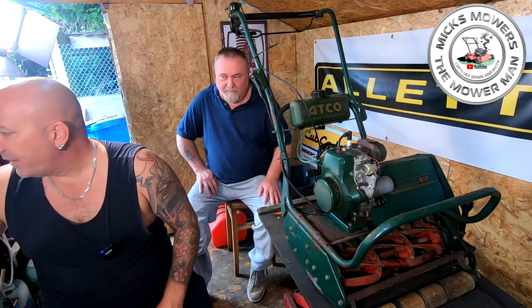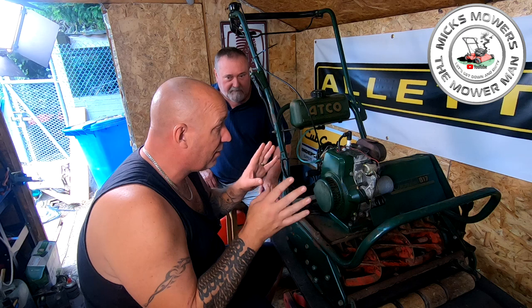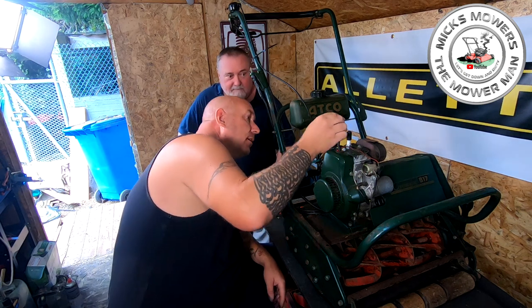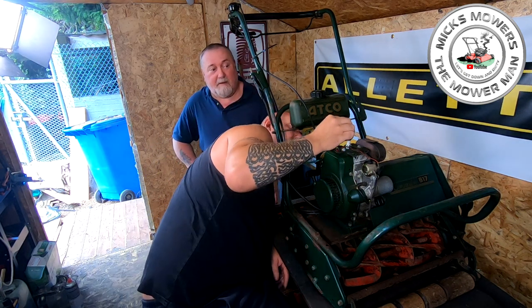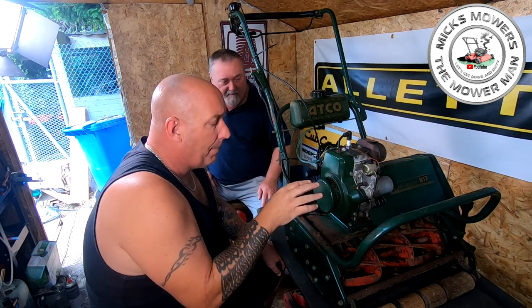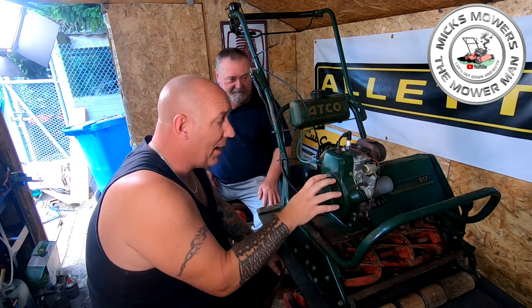But that's running lovely now. Well, it's running as well as to be expected for a machine of this age. So what we're going to do is, we'll take this outside, we'll put some more fuel in. What plug have you got in there? It's brand new. It's a B6S. Okay. I thought it was a long reach plug. We'll take it outside, put some fuel in it, top it up.